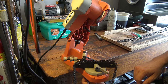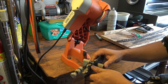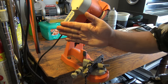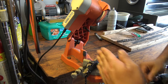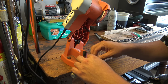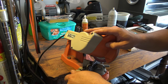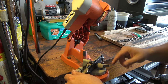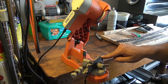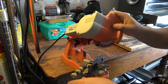Turn the knob on the underside — now you can swivel. So that was 30 degrees, so we just go back to 30 degrees marked on this side. So now, instead of cutting the tooth that goes this way, it's now going to be the tooth that goes that way. Loosen that up. Now when you switch sides, sometimes wear can be a little uneven, so you want to just double check with the cutting wheel — you might have to readjust the distance. This one's right spot on. We don't need to make another mark since we know when we get back to that black mark — the first tooth you did before — that you're done. So we'll just go at it again.